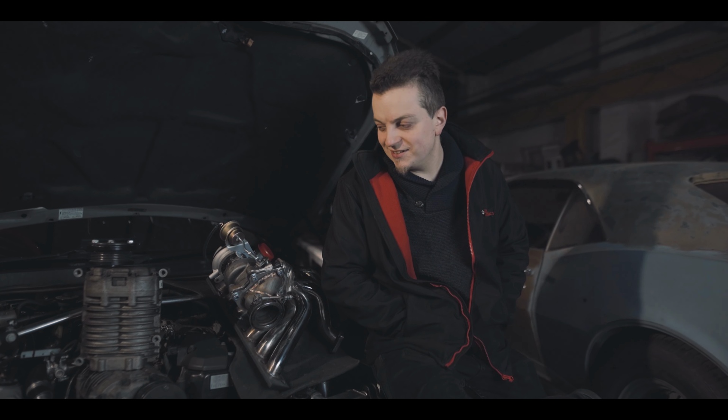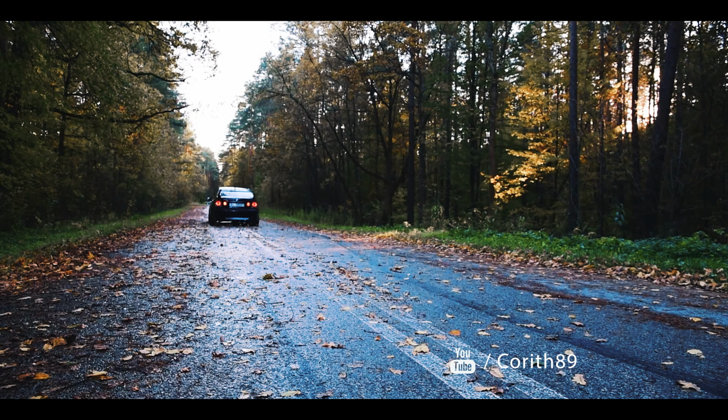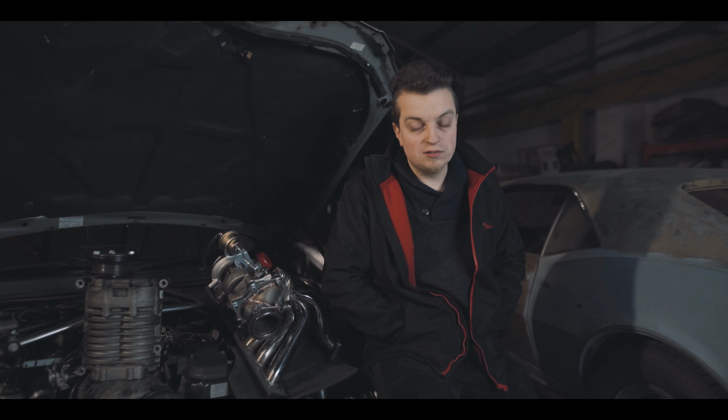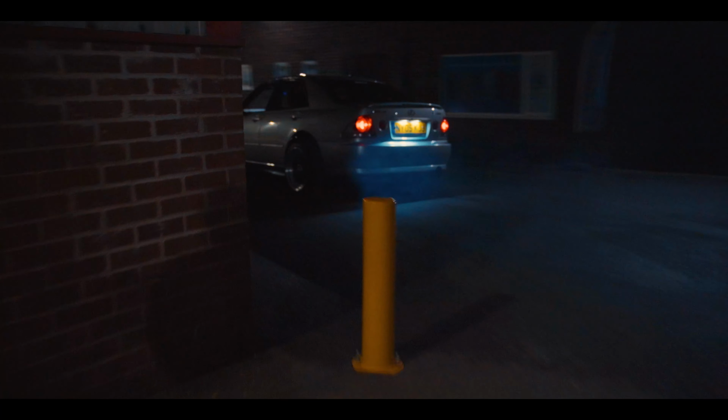Option two is the turbo. With the turbo, you get all the sweet six-cylinder boosted noises, which are just awesome. So you get rid of the whine. You've got the power throughout the entire rev range, but you've got the turbo lag. But you can easily fight it by fitting a smaller turbo. And because those engines can only get up to 300 horsepower, it's not a problem really.